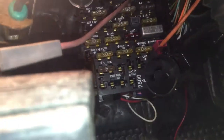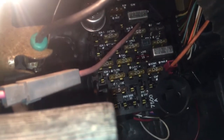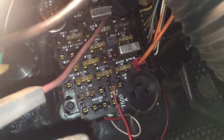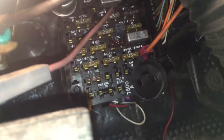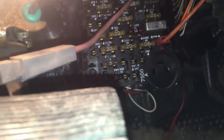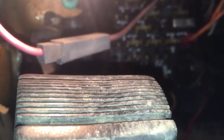Like I said, I was real sloppy with it. I just ran it through the firewall in an existing hole, up under the dash, and there's the end of it. Basically what you do is put it on a fuse block and that's your 12-volt source. You should probably add a fuse or something instead of just doing it like this, but that's what I did — this is a beater car. And it works.